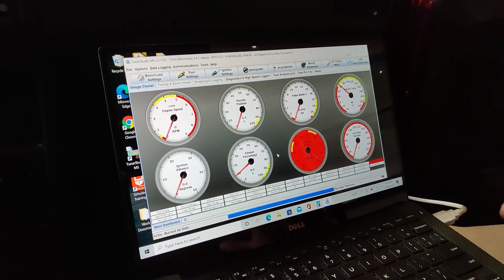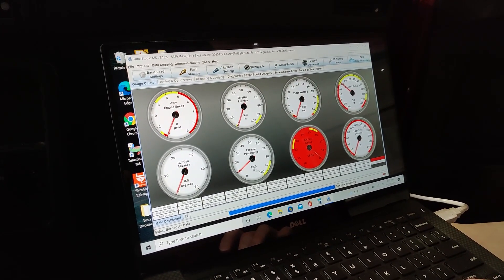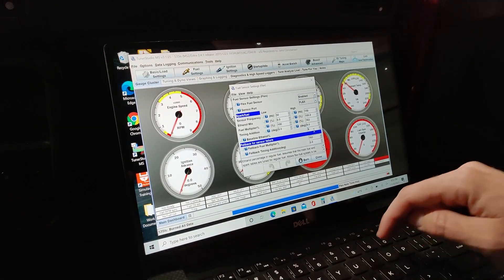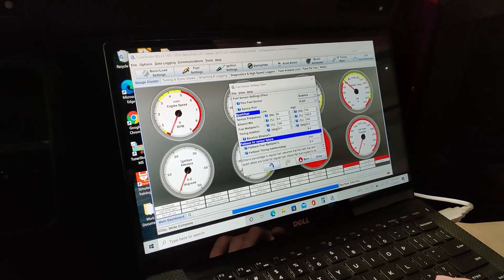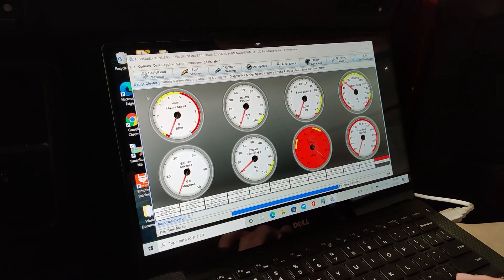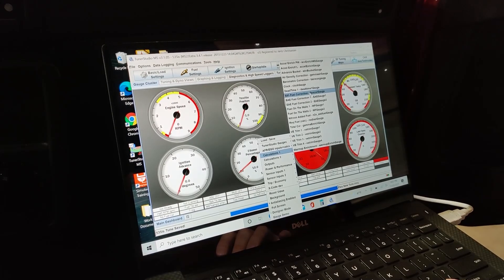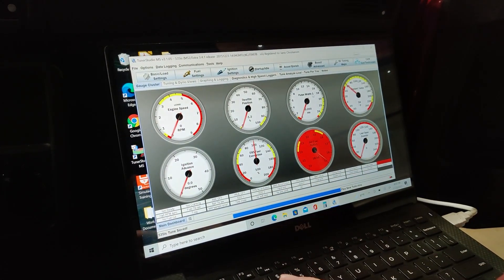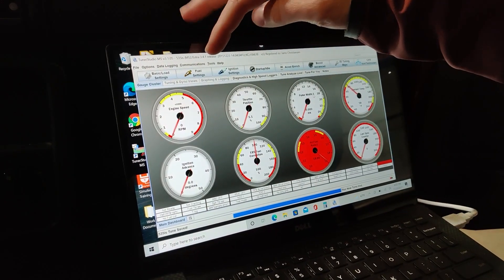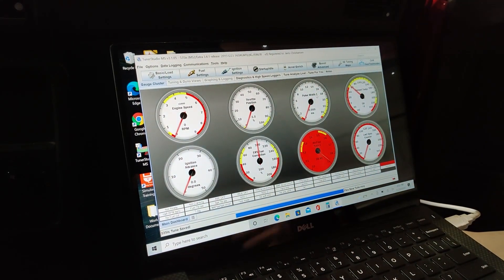You want to get your flex fuel baseline setting as close as possible to the actual ethanol content of the fuel you're using. If it's within a percent or two it won't make a huge difference. Since we're actually seeing closer to 9-10%, I put in 8 as the default, but we'll go back into the flex settings and change it to 9 to split the difference. That should be pretty good. Go in, save the tune again, and you can see it hovering around there. Check Calculations > E85 Fuel Correction — at 100% it means it's not changing your fuel map at all until you add more ethanol.